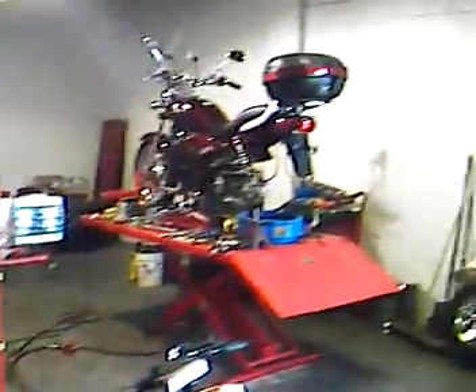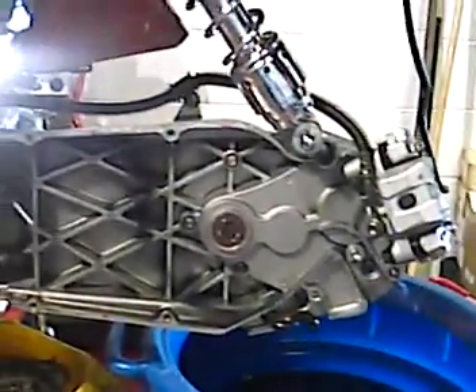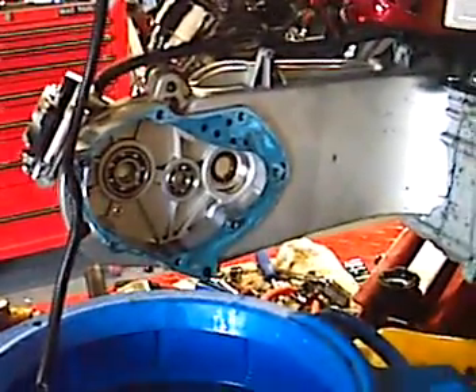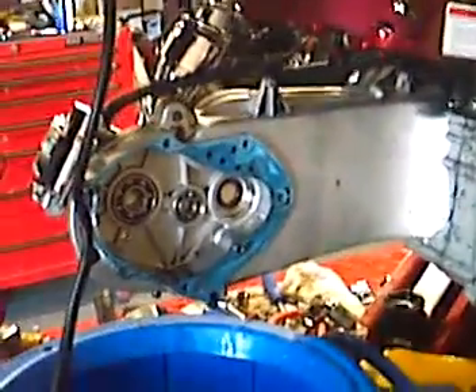Let's go to a work in progress. All MRP Speed parts are going into this bike right here — it's all taken apart right now. You'll see what we actually do with the MRP Speed parts. The clutch assembly is gone, the variator assembly is gone. There's the various parts all right there. We replace all of this with MRP Speed parts because they'll hold up to what we need them to hold up to. This is where my rear end takes over. We have to replace the transmissions and all — this kit will not work on a standard bike. So we build the transmissions and gear housings and everything else to keep up with the rear end and the torque that MRP Speed has put back into the bike. It has to be able to handle that torque.